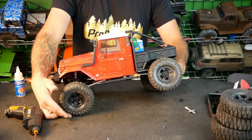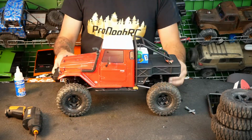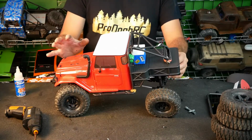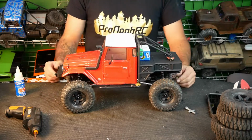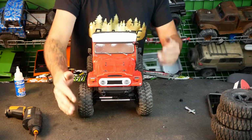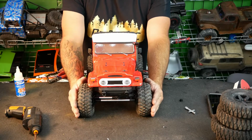With the limit in the front now, it's going to help hold that weight down. As you see now, it's trying to pick a tire here instead of trying to pick a tire here, which pushes the weight over. So we're going to use that to keep it more planted. We didn't lower anything, we just limited the front so it can't droop like the back. And these wider tires look 10 times better because the fatter tire hides the camber instead of the skinny one.